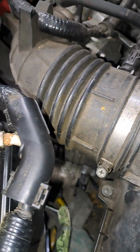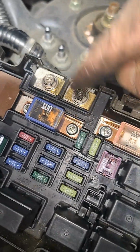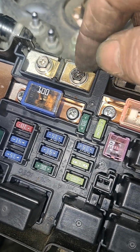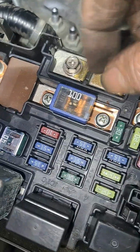When you come to the battery, hang on, let me pause this and I'll peel it open and show you. Okay, back to this. This side with the multimeter and the test light seems to be the problem. Very dim, and it actually arced when I touched it with the multimeter. So there's something wrong with this end of the main fuse relay box.